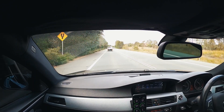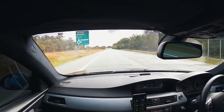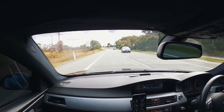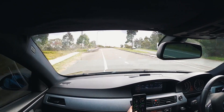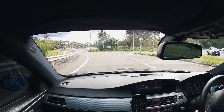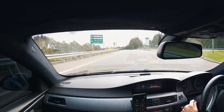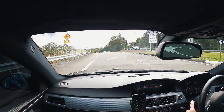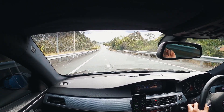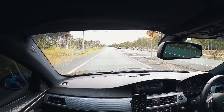We need to find somewhere safe and go do some logs. It's cute at this power level. That's definitely going to have enough data in the log, so we can go back home and check if the port injection is scaling like it's supposed to, by comparing it to the same map when it had E60 in it. We'll see you back at the house.